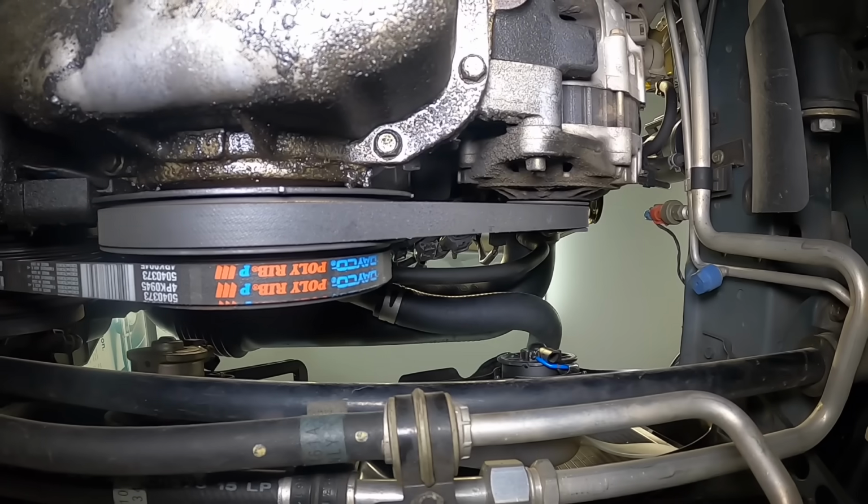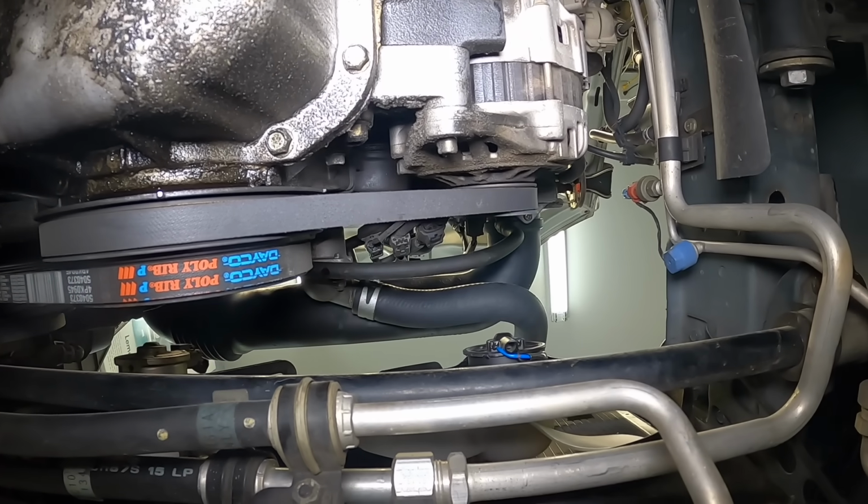Failing to fix oil leaks oftentimes can lead to other types of failure. That oil can leak down and contaminate seals, and now you have a coolant leak. It can cause damage to wires. So even minor oil leaks, we really do want to get them fixed.